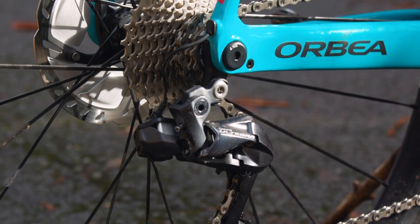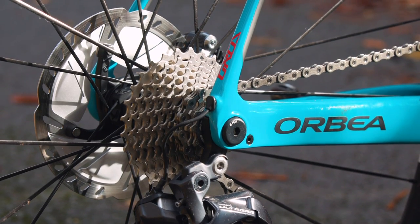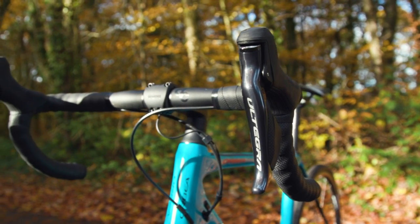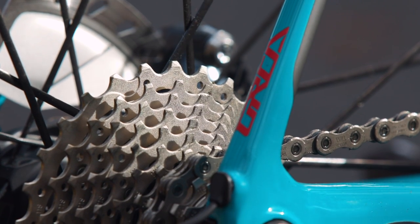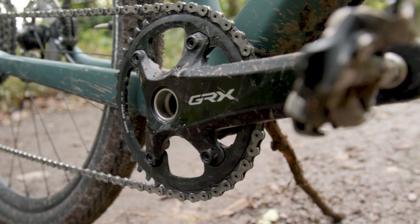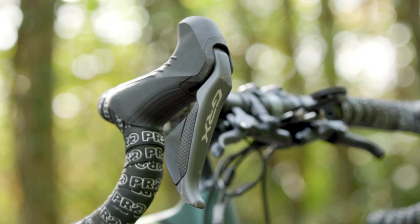Shimano Ultegra Di2 is an 11-speed, fully wired groupset. It launched in 2017, and it's available in both hydraulic disc and mechanical rim brake options. Ultegra gets fairly conventional gearing options, although Ultegra is compatible with the equivalent GRX gravel components now, so there are some new gearing options more aimed at adventure and gravel bikes, as well as the option to go 1x, but there's some compatibility stuff which we'll get into later.